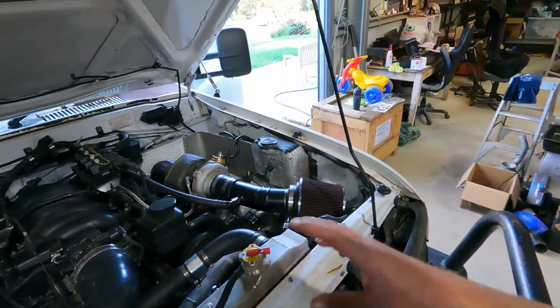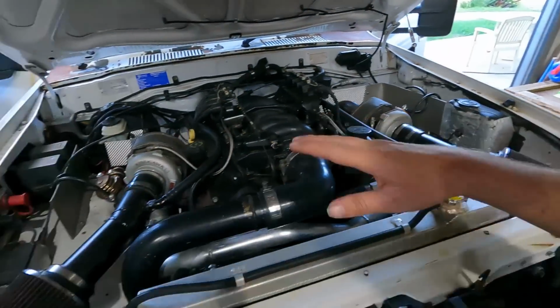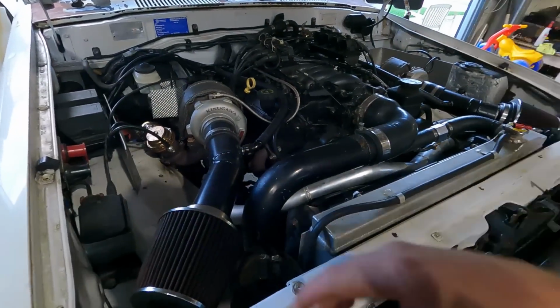It's pretty wild. So we've been investigating what's going on there now, and we've found that there are more leaks, multiple leaks from these gates. Rex fixed the ones that were obviously leaking, preventing the gate from holding the diaphragm shut. Now we've realized that there are a lot of other leaks which are preventing the diaphragms from opening properly. So Rex has gone through this afternoon and basically ultra coppered the crap out of everything he could to try and get the gates to seal.